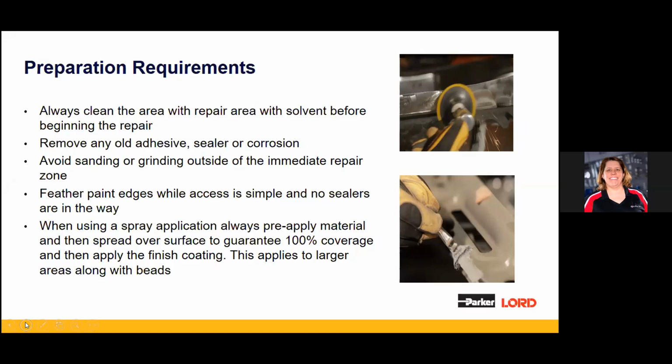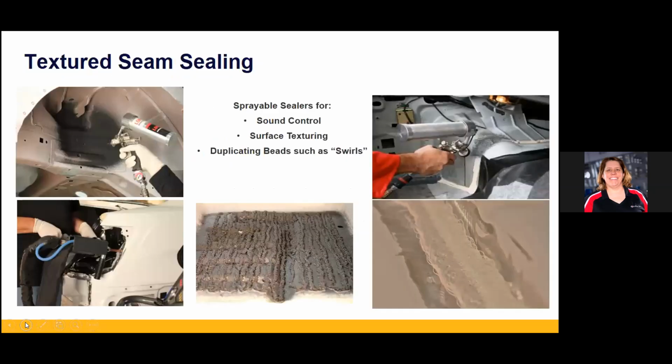Absolutely. Even the grit, right? You can see in that picture, that's an 80 grit. That's what the OEMs want, anywhere from a 60 to an 80 grit. That's what we need. We don't see a lot of 36 grit anymore, other than maybe sharpening lawnmower blades. That time of year. Yeah.